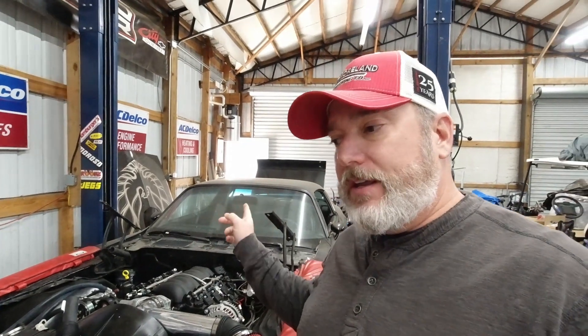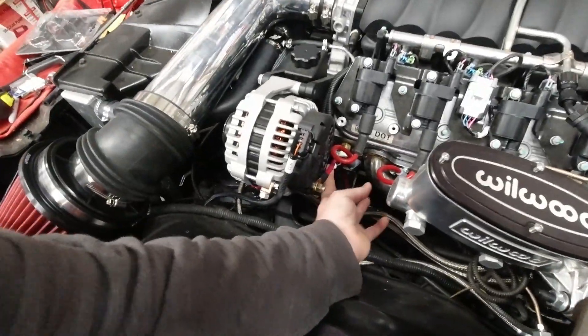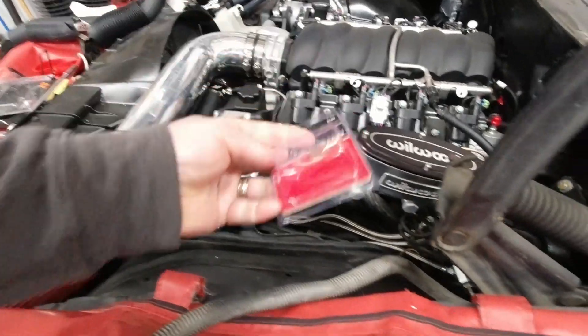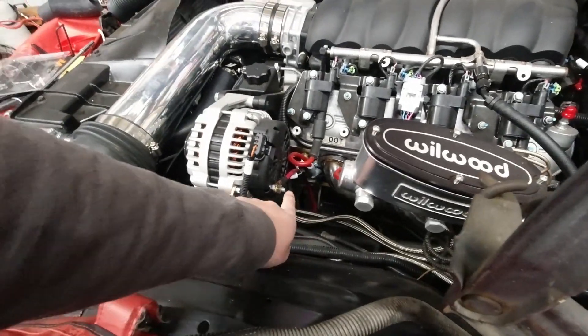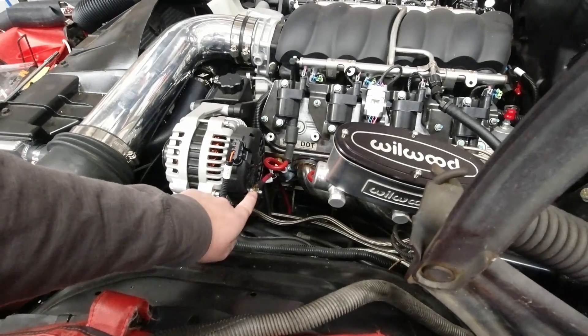What I've done is I've run the battery cable from the trunk down the frame rail and up to the starter. I bought a 10-foot section of 6-gauge wire down at my local auto parts store, and I bought some fittings, cable lugs, cable ends, so I can make up my own cable. I wanted a nice fat wire so we don't have any problems with resistance.